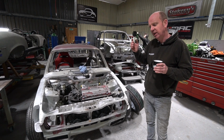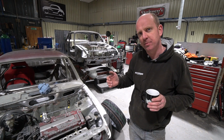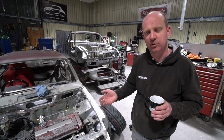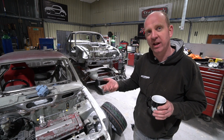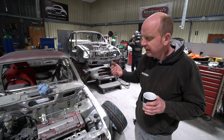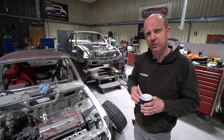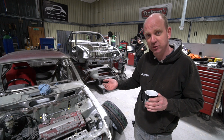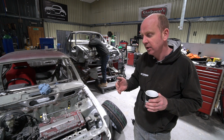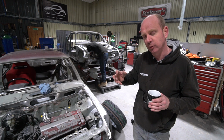An area that we have had many problems with is the permeation of fuel vapour through fuel hoses, particularly fuel filler hoses, causing a smell inside vehicles, and generally fuel hoses not being of a sufficient standard to withstand modern fuels with high ethanol content. And finally, after searching around and going to all sorts of sources that I thought should know how to solve that problem, we found a company that could, and that was Goodflex Rubber, who supplied us with FKM lined fuel hose.